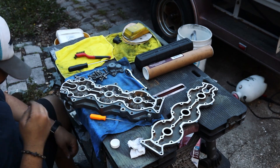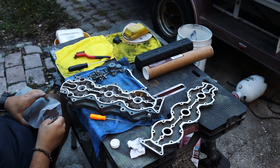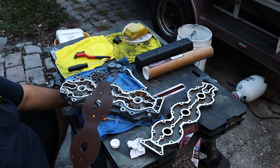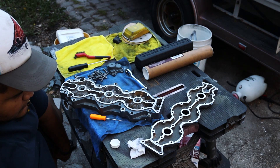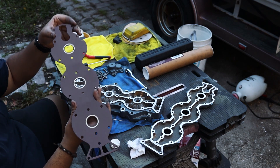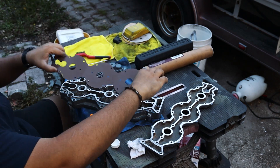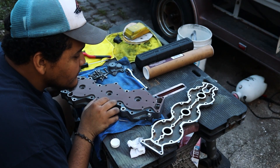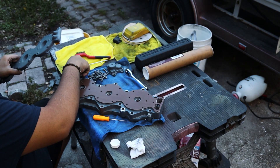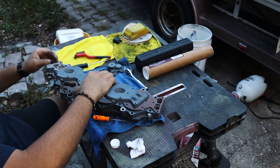Surfaces are clean. I'm going to go ahead and grab my gasket. This is the new water jacket cover gasket. It's pretty easy to tell how it goes because the shapes match. The side with the white rings are going to go towards the cylinder head, and this is going to be the back facing the jacket cover. Just try to get it lined up as best as you can, then get your water jacket cover and put a couple bolts through some so that way you can get it lined up.